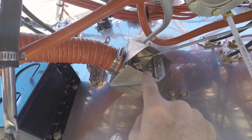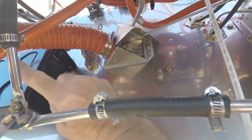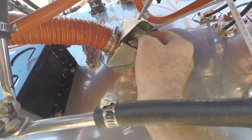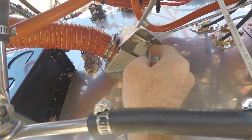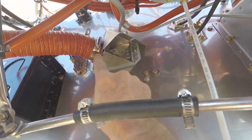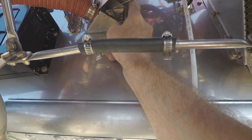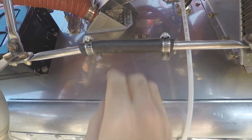There's one here in the front — that one is for the cabin heat. The heat muff comes in through here; if you want cabin heat, open that to get the heat inside, close it to stop it. I put a shroud on here so that when air is not going into the cabin, it will push it down and out the tunnel rather than blowing it toward the oil cooler.